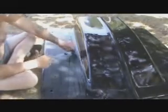I made a little squeegee from the bottom of a screen door or something. Handy, cheap little way to do this. It really comes in handy to have a little squeegee so you can look at your work. I would say it's especially critical when you're color sanding because you don't want to take too much off.